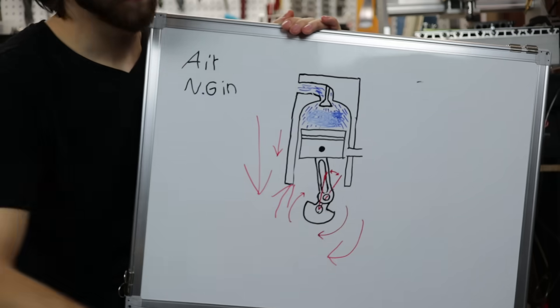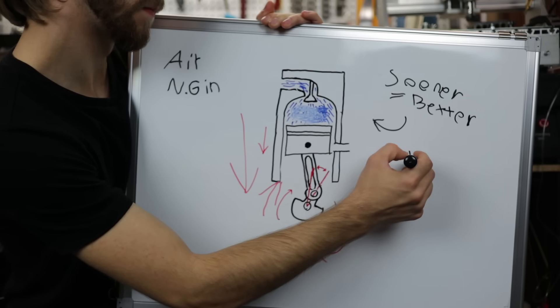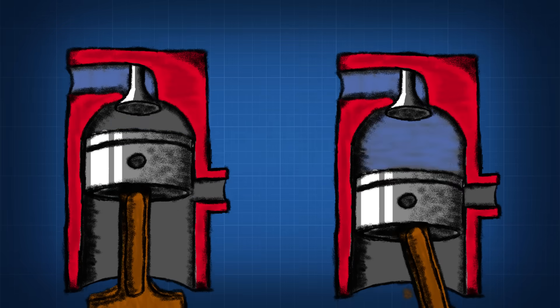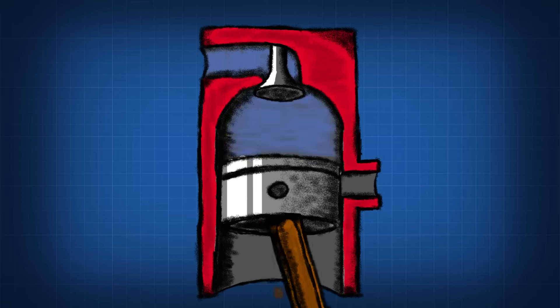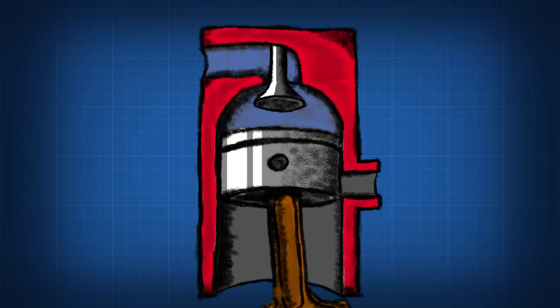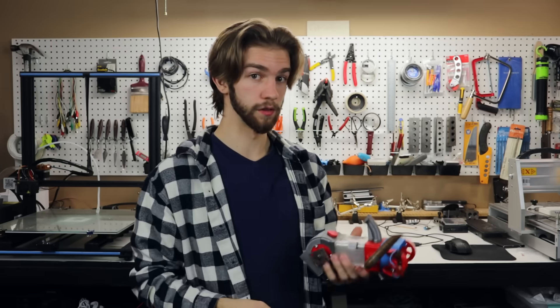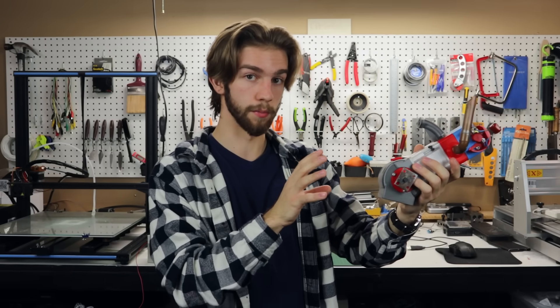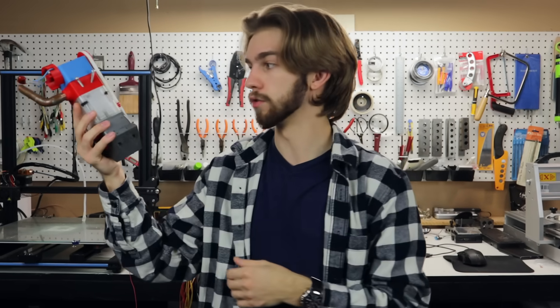But there is a solution: open the intake valve at or just before top dead center. This way, at high engine speeds, the air is given a longer period of time to pressurize before the piston can move downwards. But because the air is now entering sooner, if the engine were to slow down, it will try to run backwards and stall. That's where things get interesting — if you gave an engine variable valve timing, you could have it optimized at low RPMs, and then advance the timing as the engine speeds up.